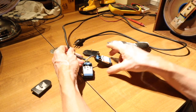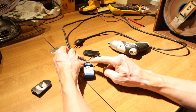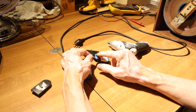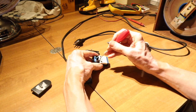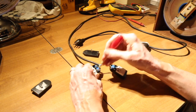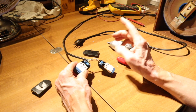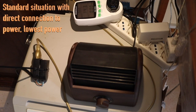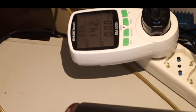That's how you build this. You have to take care that all the connections are good — that these clamps are well done, well connected. So that if you pull here, it will not pull here. Also always check that these connections are really well done. In this case, the earth connection is going only to one; it would be more correct to connect it to this one as well. This is the situation with the fan at the lowest speed — the reading is 14.2 watts. You can hear it — it's making quite some noise.